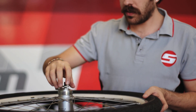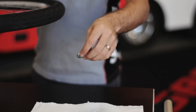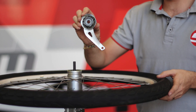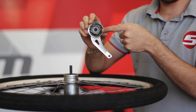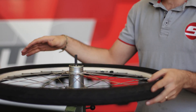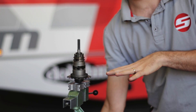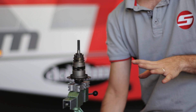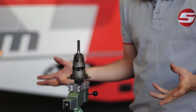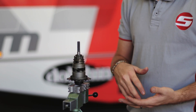I'm going to unscrew the top one and then the second one. This is going to give me access to my brake coaster arm, which is going to come off as one piece with my bearings and a retainer so that I'm not going to lose parts while I'm working on this hub. Now I can remove the hub shell from the guts of the hub. I can pull the wheel up and everything remains on the axle in the vise. There's nothing that's going to unspring — no pawls are going to come flying off. I can then take this part and replace it with my new guts.